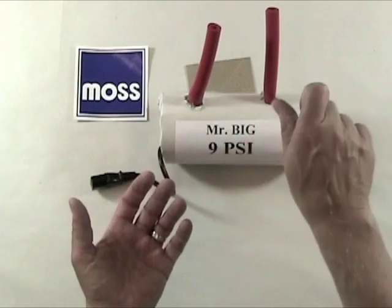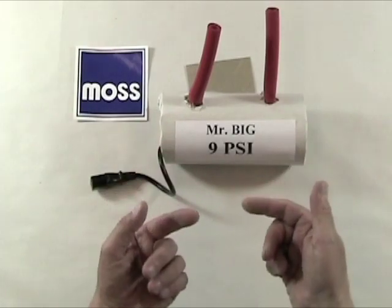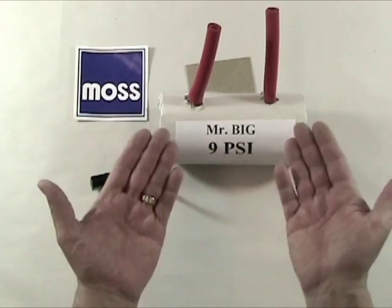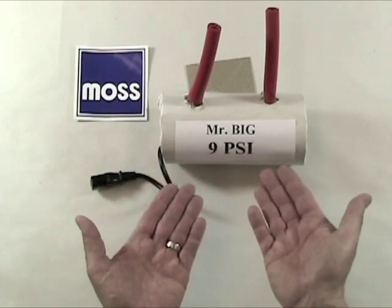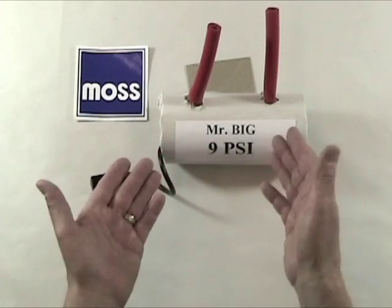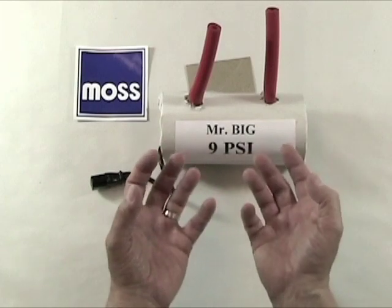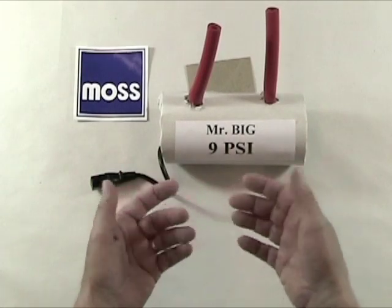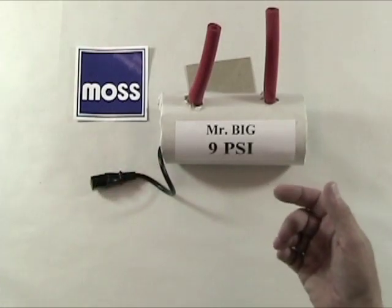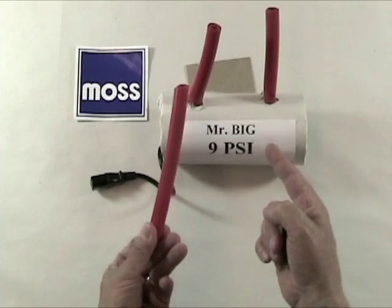And now with the motor off and the key still in the on position, gasoline starts running out of the air filters. Well, even the Three Stooges could figure this out. There was obviously too much pressure for the SU carburetors. So instead of looking for a more compatible fuel pump, a Band-Aid solution was chosen, a pressure regulator. A new pressure regulator would allow the Mr. Big fuel pump to stay in the car, and the new pressure regulator gizmo would really look cool under the hood.